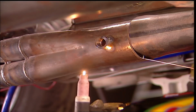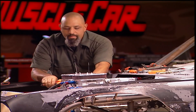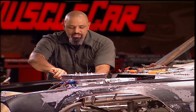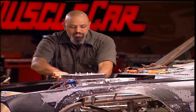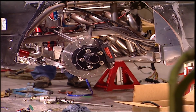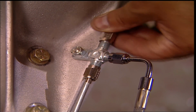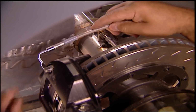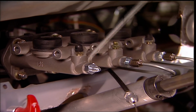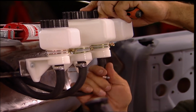Even for a test fire, the O2 sensor still needs to send information. Short of the main battery leads and wiring up the ignition, we're almost ready to start. Now, like I said earlier, I'd learned never to fire up a new project without working brakes. Cars have gotten away from over-anxious builders before. No positive endings there. Yeah, I could have pulled the drive shaft, but I need to know if all these parts are going to get along with each other.